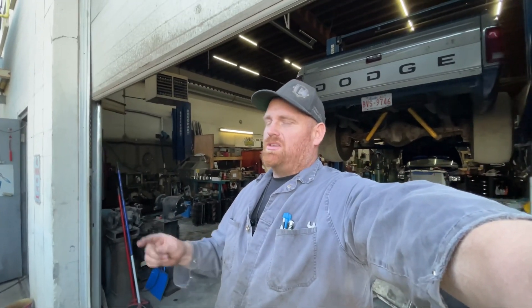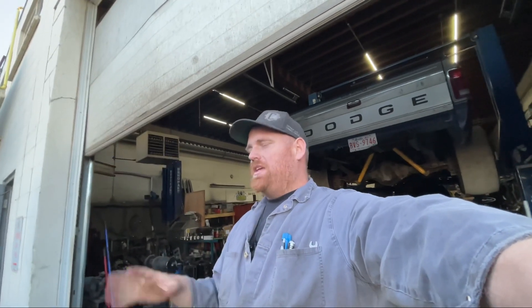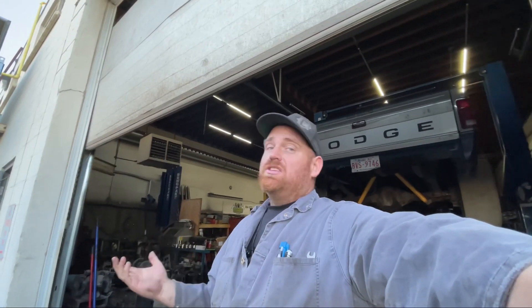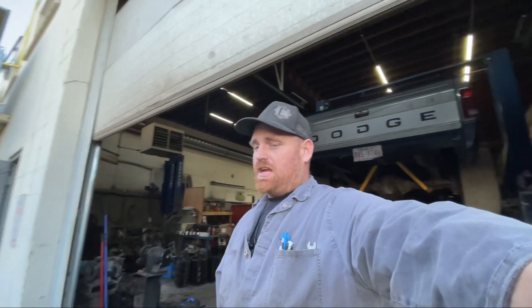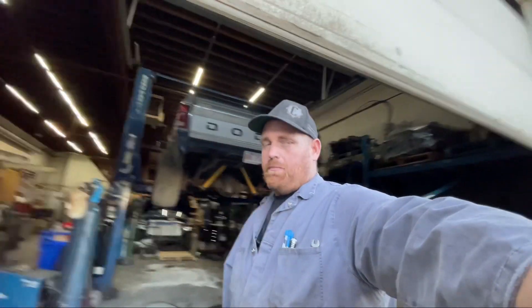The fuel mileage side of things — it has got a little bit better on fuel. We burnt about 20 liters less on the trip back and forth to Edmonton than the one before. I never figured out exactly because I have to set up my metering block to actually measure fuel usage. But it definitely took a whole jerry can more fuel the time before than it did this last time — so about five gallons difference. Same truck, same trailer, Jason was in the truck with me, and the ambient temperature was roughly the same, within maybe five to eight degrees.